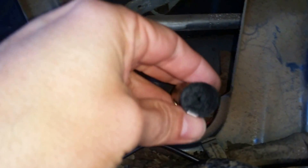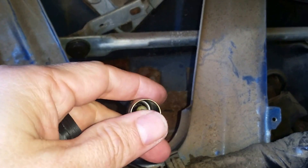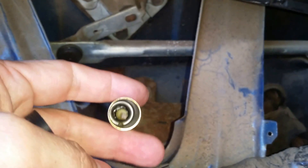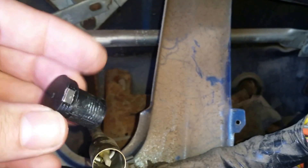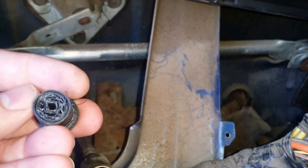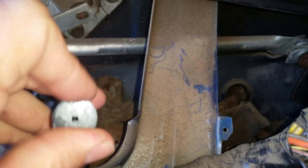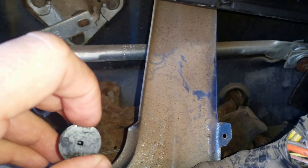Now I'm inside the vehicle, and as you can see the instrument panel has already been removed. You might find that you have a speedometer cable coming from the axle, which makes it quite easy. There's a square rod that spins inside the round housing, and I 3D printed an adapter to go inside with a neodymium magnet on it. It has a square key so it fits on there, and this will spin when the vehicle is moving so you can read that magnet off of a reed switch.